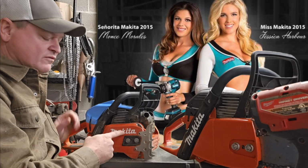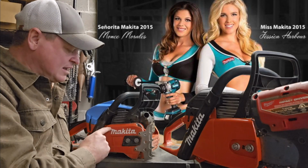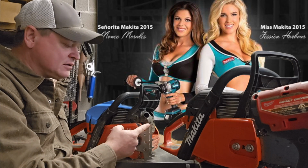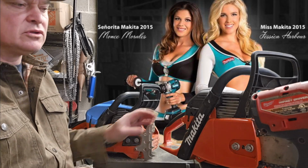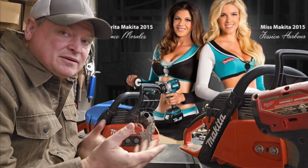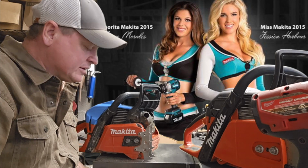The Makita, however, well, they're both Makitas. The 5600, however, is a farm and ranch grade saw, and it does come with captured bar nuts. Nice, right? No captured bar nuts here. And it has the provisions for the outside dog. Now I will say that the dogs on the 6100 here are really big. Too big if you ask me, but I'm in hardwood country where we don't need those great big felling dogs. This right here is just fine for me, everything I do.